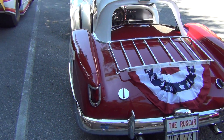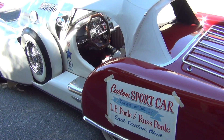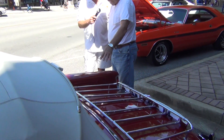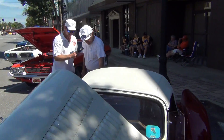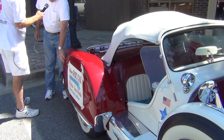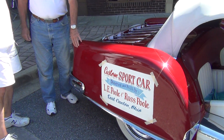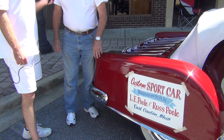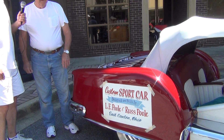This is all made out of pieces of other car bodies. There were about 28 pieces back here. This is a piece of Plymouth top, this is a piece of 46 Hudson hood, this is a piece of 40 Chevy hood, and this is a piece of 39 Chevy top. Is this fiberglass or metal? Oh, steel — it's all steel. Amazing. I gas welded it. Learned to gas weld in high school. And then we leaded it — the old school lead. Wow, that's amazing.